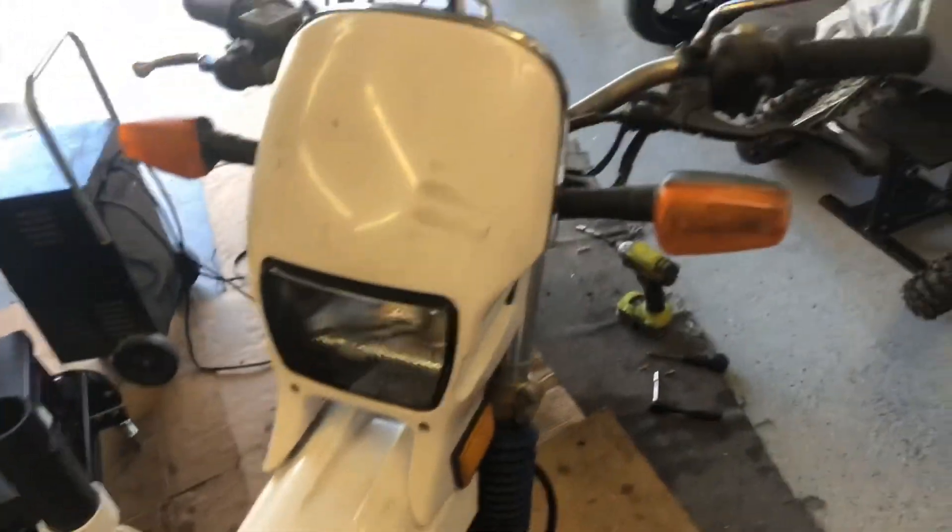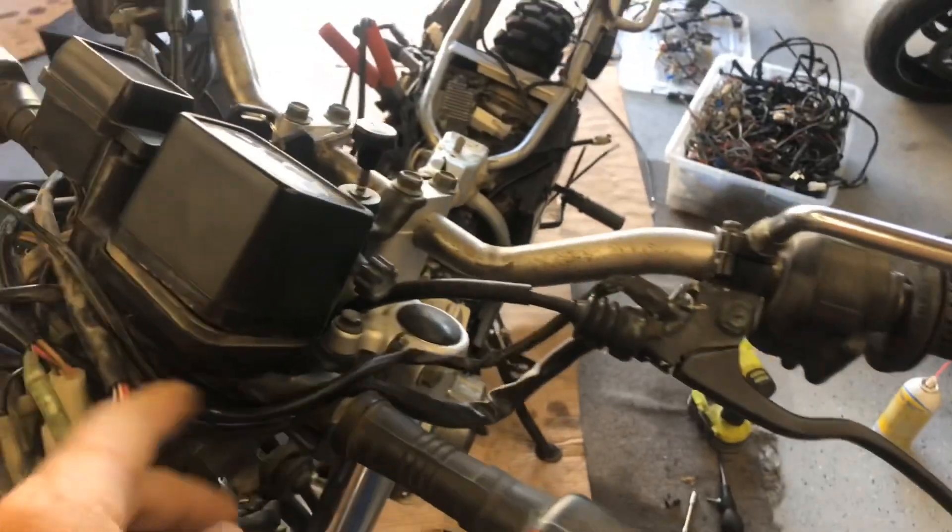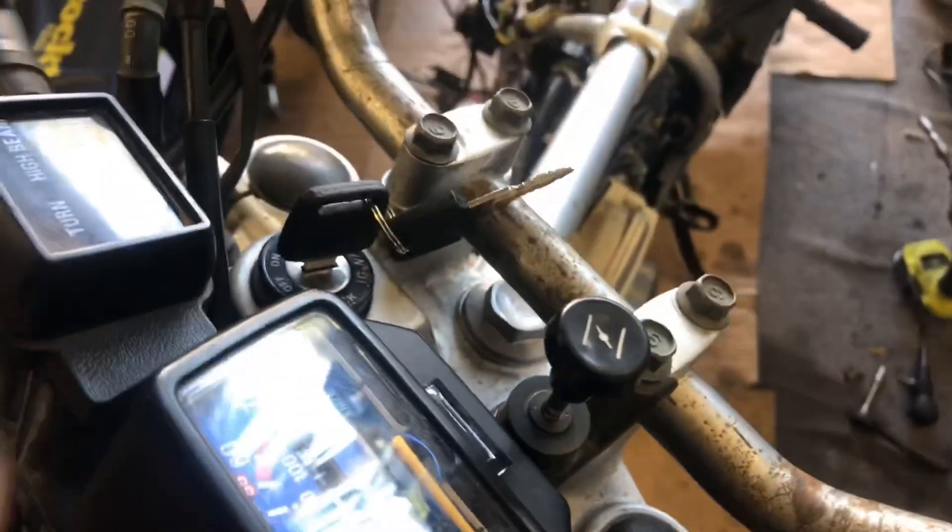When I was tracing the clutch wire up here I found this mess. Look at this — who uses butt splices like that, and then just tapes them? Looking at this, some colors are the same and some are different, and I think by the look of these keys we've got an aftermarket switch wired in here, done in a very professional manner. I mean, I'm not a wiring expert by any means, and I do some shady stuff too, but hey — if it works, it works. This doesn't look like it works.